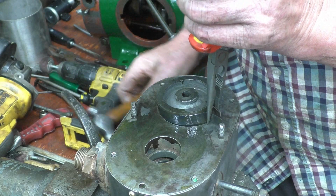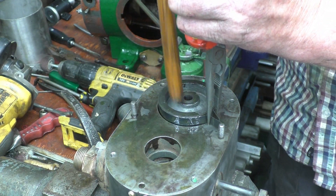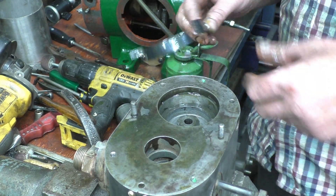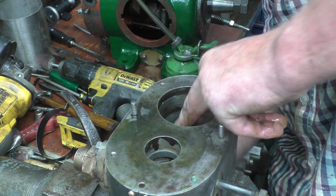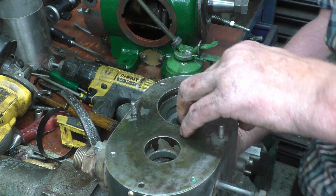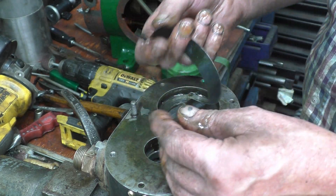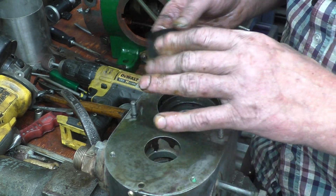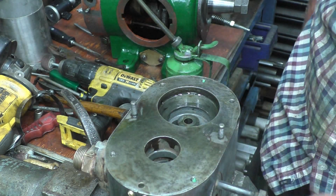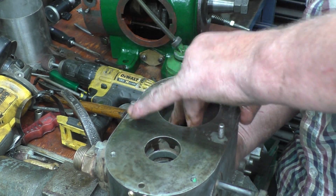So that drops down into the bore like that. That's in now — I know I haven't broken a ring because you can tell, you'd have to hit it with a big hammer to break a ring. That's gone in quite nicely and I'm happy with that, and it's even the right way up. You can feel the rings gripping — this engine hasn't even been run, so that's the biggest obstacle out of the road. That's a nice simple little tool, probably similar to what the factory used to put it together. I'm really happy that that's gone in like that, really happy indeed.